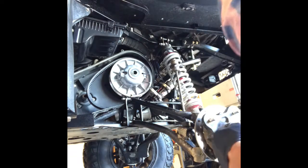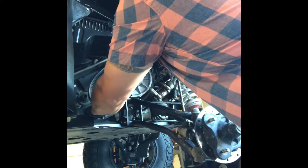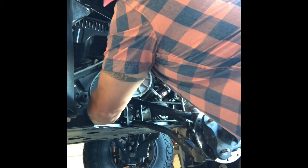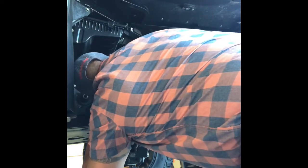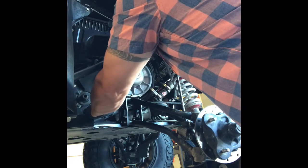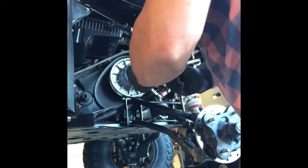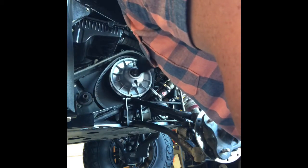I'm going to grab this sheave tool. I'll move this side. Oh baby, come on. Well, she hates me at the moment. Typical. Okay, well, it's a little end that's going to work, so let's go ahead and put that bolt I saved, that I can't find, over here right in front of me. Okay, I'm going to throw that back in there. And we'll crank the sheaves open, let the belt settle in.